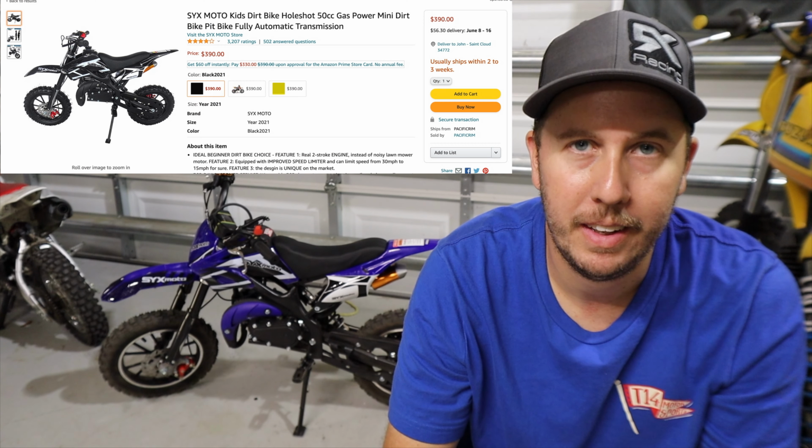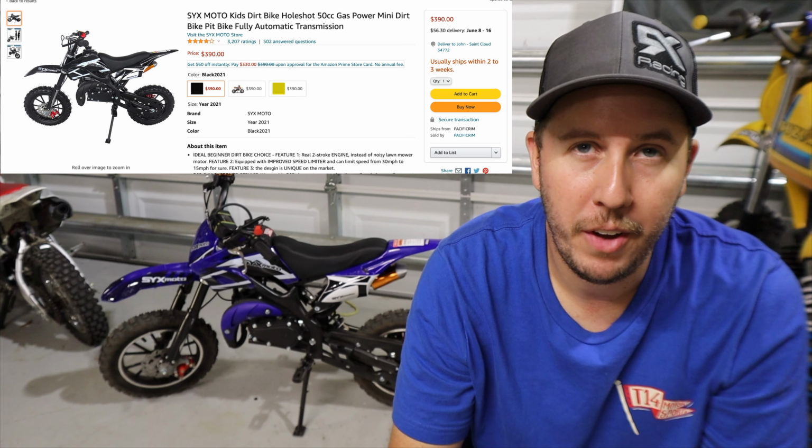Okay, so I hope you enjoyed the process of assembly of the SYX Moto Holeshot dirt bike. This was a dirt bike that's on Amazon, and I'll put the link in the description below the video. My thoughts on the assembly were there were some challenges because of the fit and finish of the bike. Obviously it's a bargain bike. It's on the budget end of the spectrum. You're not going to have the fit and finish of the $1,000+ Yamahas and Hondas. Basically, the most challenging part to me was the lower shock bolt. The holes on the mounting ear just didn't line up.